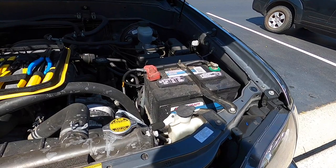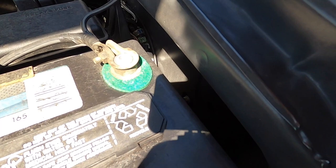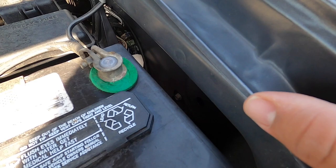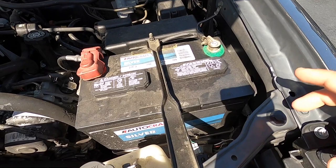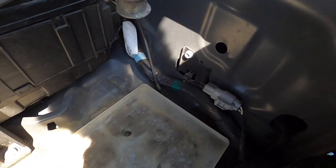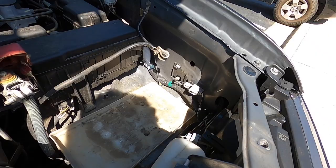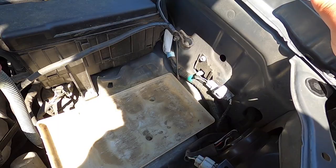We are outside and we're going to be putting in the headlights. First thing I want to show y'all is a trick: take the battery out, because we're going to have to reach behind here. If you're going to install LEDs, there should be a gray clip — I'll show y'all once I remove the battery — and that is to disconnect the daytime running lights so you won't burn out your LEDs. I recommend doing that to give the LEDs a much longer life. Once you remove the battery, you have clear access to it — this controls the daytime running light, so all you have to do is just unplug it.